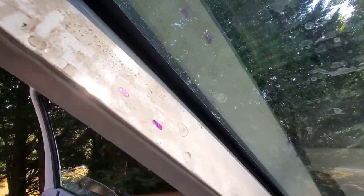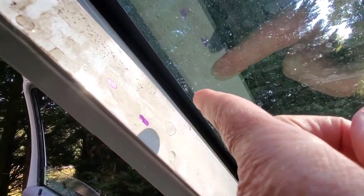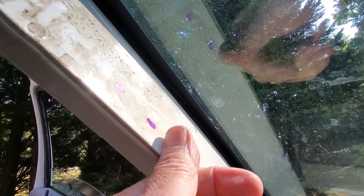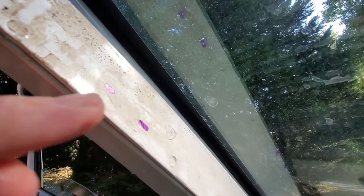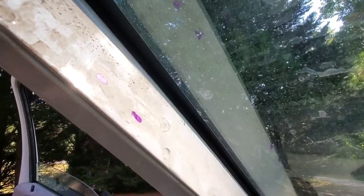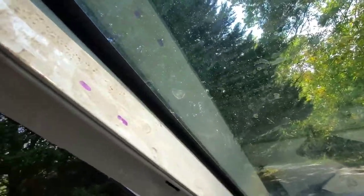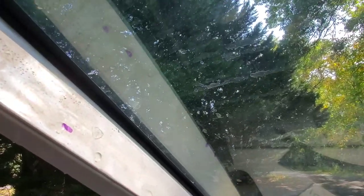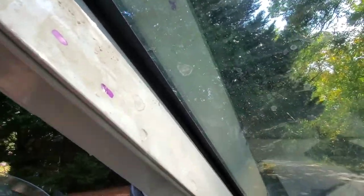You can see where my marks are. It's going to be kind of hard to drill from this side, so I'm going to get a small drill and go through at a bit of an angle from this side to clear the windshield. Then I'll do the actual hole from the other side where I've got more of a straight shot. From this side I'd have to drill at an angle and I'd be very afraid of breaking the windshield.